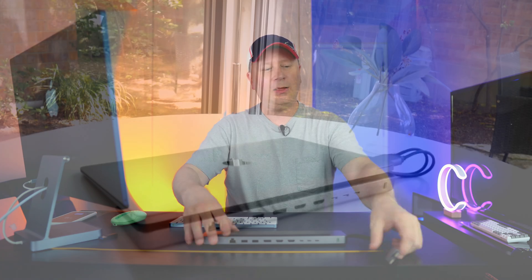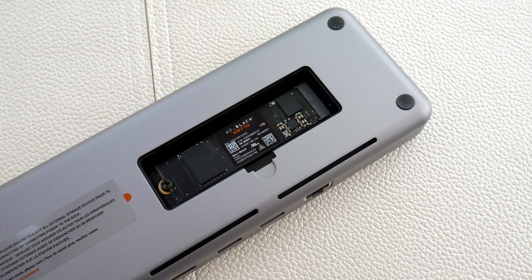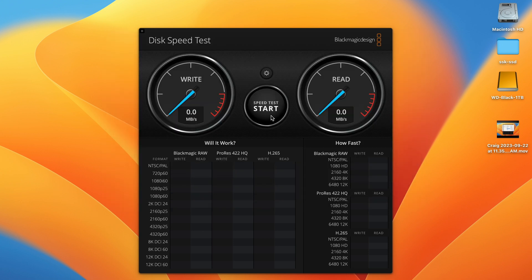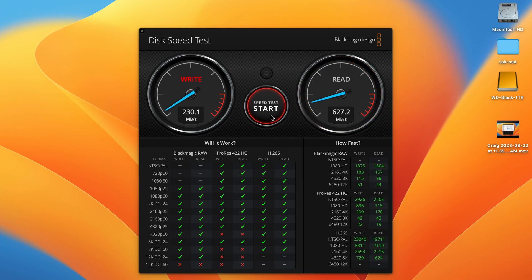Anyway, I like the hub overall. I don't do full reviews — I just wanted to showcase the features. Everything has been working super solid for me with no heating issues. Let's do a little speed test. I'm going to select the Western Digital Black drive and run it. Using the WD SN770, we're getting 733 on the writes and 627 on the reads. One more test: 758 on the writes and 651 on the reads. All different drives will have different speeds. If you use a SATA drive, you might be around the 500s but with cooler temperatures. You just have to pick what's best for you.